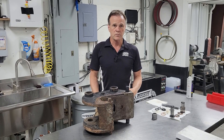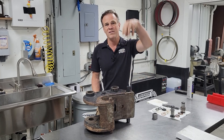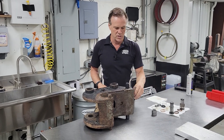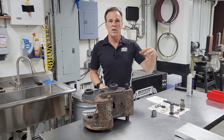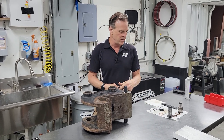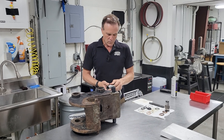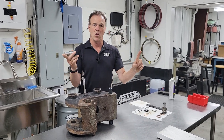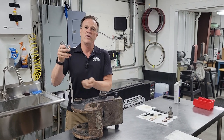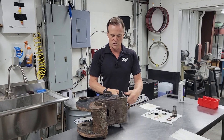Once you've gotten one side out, the process to get the clip out is the same. At that point, the spring will just lift out. Turn it upside down — now you can just tap the socket. You don't need to press because there's no spring pressure left on the other side. Put your socket, just tap it with a mallet. Take that circlip out, and then you can stick a long 3/8 extension through the device and just smack the whole thing out the other side — the second piston and bearing assembly — just knock it out onto your bench.